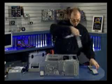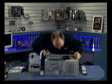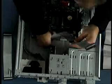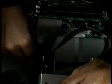I'm going to install the two ATA cables first. The blue connectors go to the motherboard. Looking at the board, the primary ATA or IDE is the black one, and the white one is the secondary. You want to observe the pin one orientation — the red stripe on the cable goes towards pin one. This being the primary, I'm going to plug this one into the hard drive. As far as the drive is concerned, pin one is almost always oriented towards the power connector on the drive. So now that cable is installed.